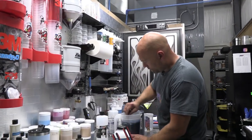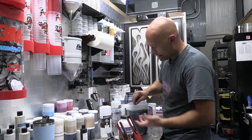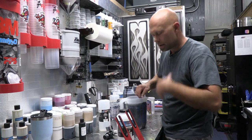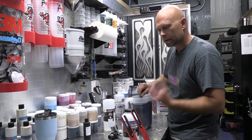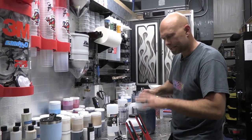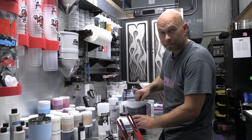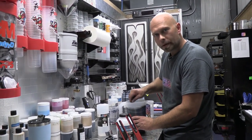Get this mixed really well, then let it sit for about 10 to 15 minutes while I go in and sand out that little drip. I've mentioned this in other videos — once you reduce it, let it sit for 10 to 15 minutes to really let everything get acclimated. The reducer breaks down the surface tension of the paint so it becomes one uniform mixture. When you're reducing water-based paint, it's not as fast a process as solvent-based. Water-based tends to float and separate a little bit, so you've got to mix it up really well and then let it sit.